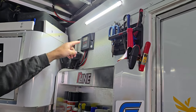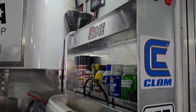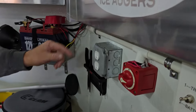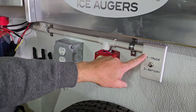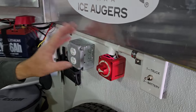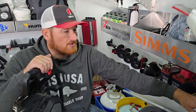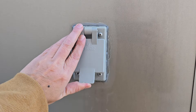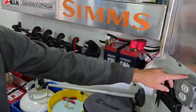Here's our second solar panel going up — it's a separate panel on the roof outside running a separate battery. When you look down here, we used a little bit of PVC pipe to hide all the wires. What I've got here is a switch that allows me to run off the truck when it's plugged in and running, or off the trailer battery with all of the lights. We've also got a shutoff switch so we can kill all draw — for the off season or to prevent accidents. We've got a little electrical box with a through-junction so we can get power into the trailer without jamming a cord in the door and letting in water.